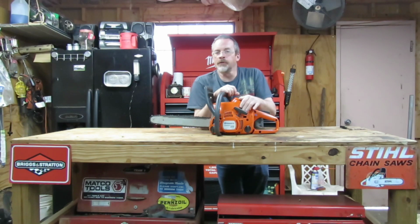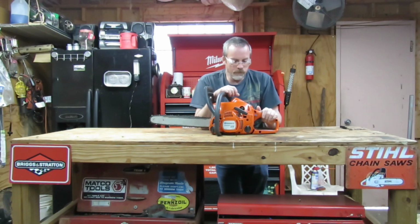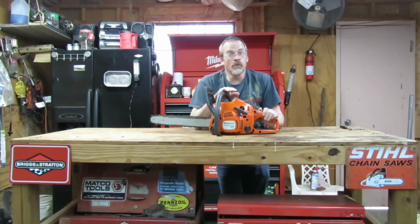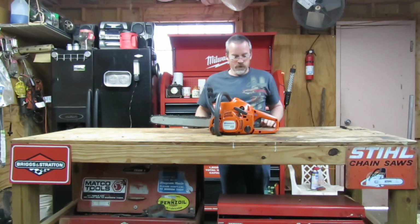I may do a video later showing y'all how to do it if you've turned the idle screw. But for now, I know this one hasn't been messed with. So I'm not going to mess with it unless I need to. And usually you don't need to as long as it hasn't been messed with. As long as nobody's been in there turning it, just leave it where it was from the factory. You'll be able to adjust it in really easy from your low and your high speed screws. So, let's get started adjusting it.